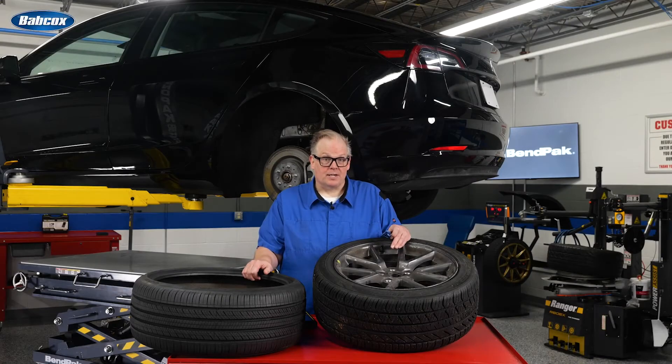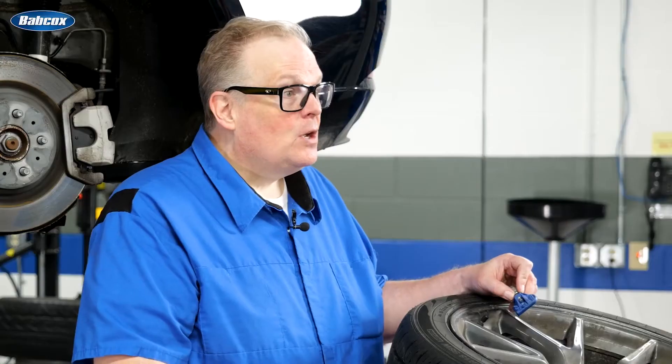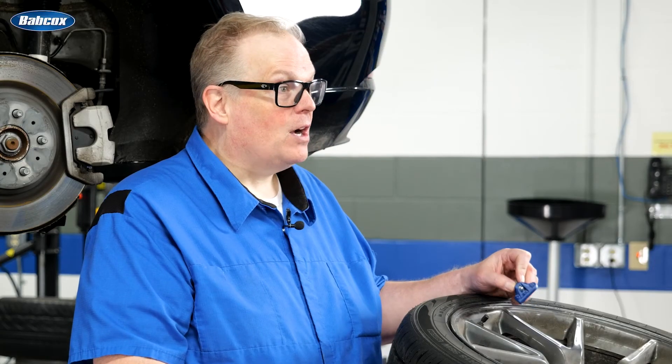If the tire pressure warning is displayed, exit the vehicle, close the rear trunk and all the doors, and wait for the touchscreen to go black. Then re-enter the car and ensure that the correct wheel size is selected before touching reset. Touch reset and then touch OK. Press and hold the scroll wheel and select car status to see the overview of the TPMS information. When the sensors are unknown, all the values will be a dash dash.